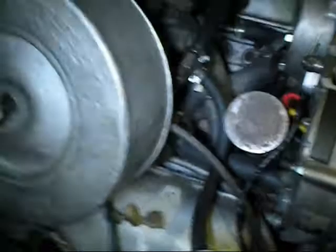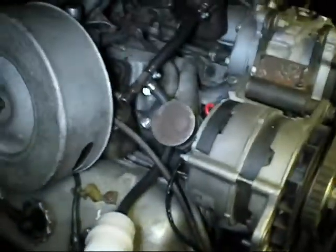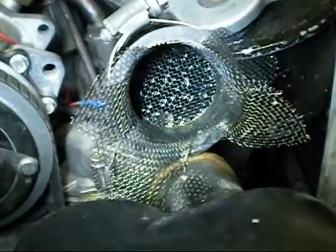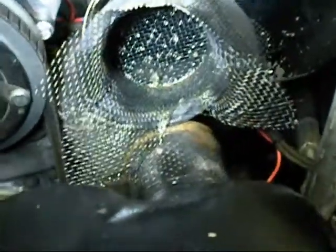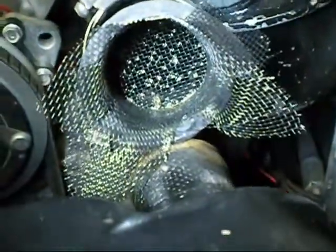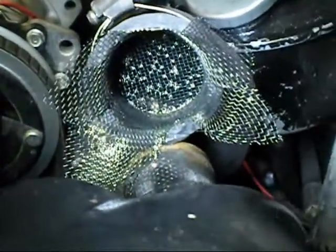That was quick and simple — it's not touching anywhere, very easy. I just popped the top hose, and my little filter has caught a fair bit of shit. When I took it off, you can see what's flushed back down the hose — all those bits of rust and crystallized coolant and bits of crap. They'll have a good look when I get the hose off. This is why you put a filter on — otherwise you'll block the radiator you just got cleaned.